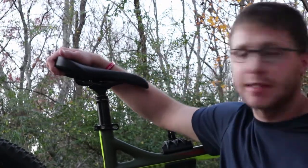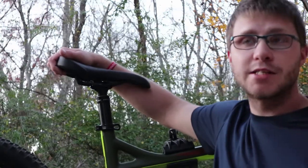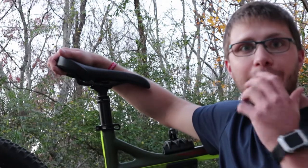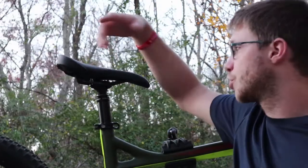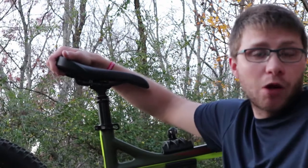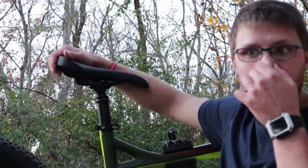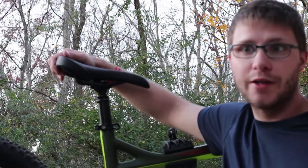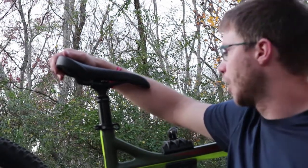So I got in contact with X-Fusion over at Mad Suspension in California, and they were like, yeah, it sounds like you have this issue. They got me a new air shaft, which is pretty much 2 bolts, and then you pop it in, pop it out, grease it, and it's worked ever since. So for something as cheap as I got it, and how easy it is to service, if something were to ever go wrong, and with parts being available, it's been great.